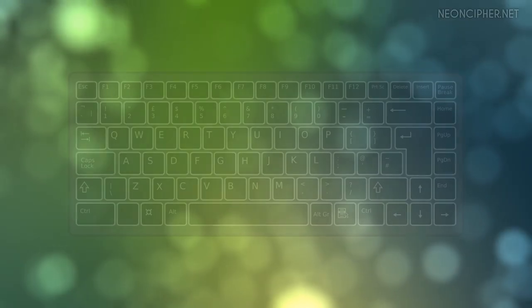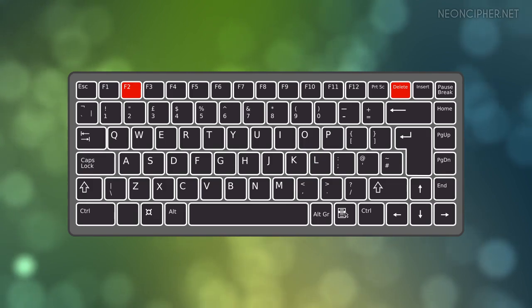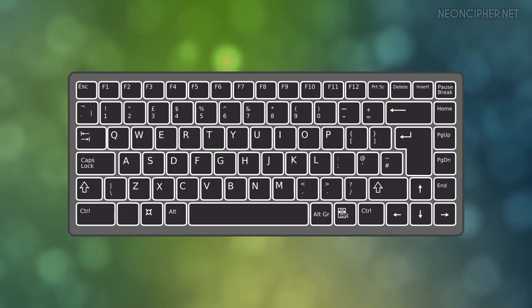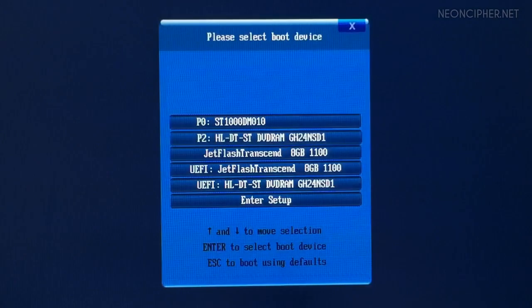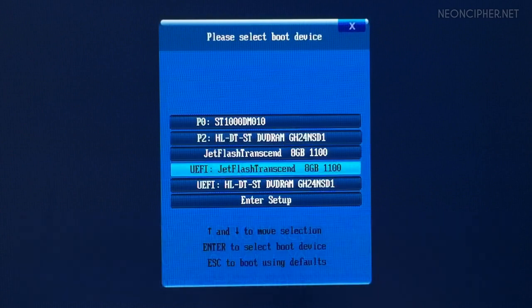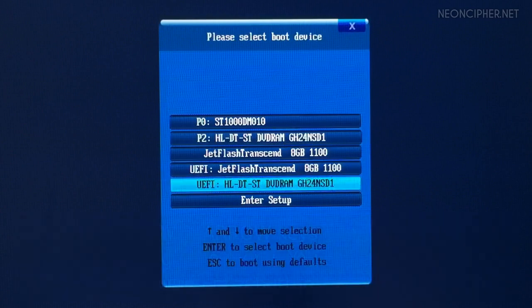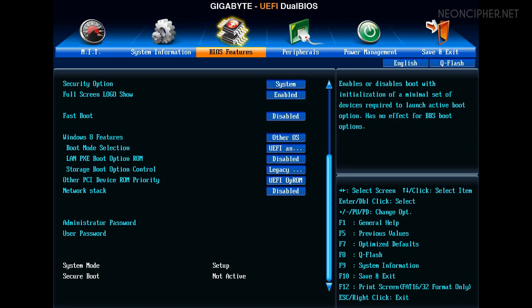To enter the BIOS configuration mode, keep pressing F2 or delete key on your keyboard when turning on the computer. You can find out which key to use in your laptop or motherboard manual. Some motherboards provide two ways of booting up devices, the regular one and UEFI mode. In that case, make sure that you choose the line that mentions UEFI. If you have problems booting up from the installation media, watch my detailed tutorial on how to do that. I'll put the link in the description below.